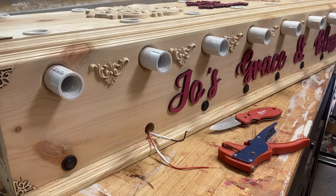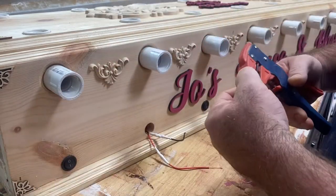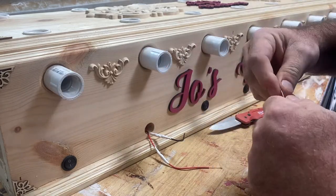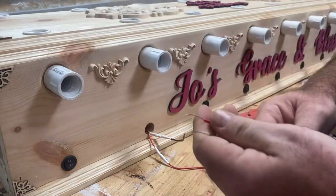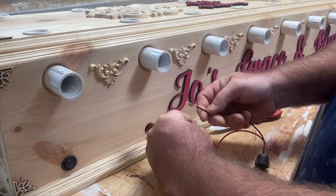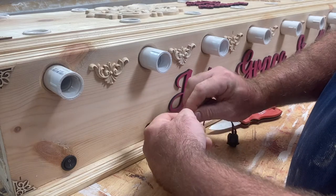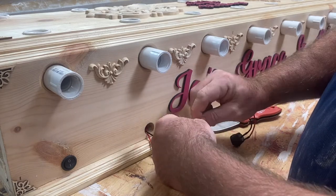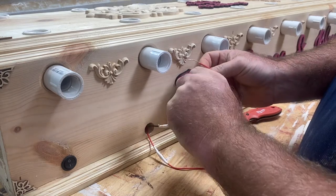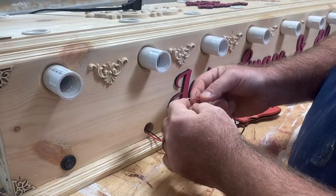Here we go. I can tell you where to get all the switches and motors — they're very inexpensive and I very rarely have problems with them. So as you saw: just cut, strip, twist, and then black to black. Oh, and everyone — I was doing this with it plugged in. I haven't gotten shocked yet, but that's probably only a matter of time. Let's unplug it.